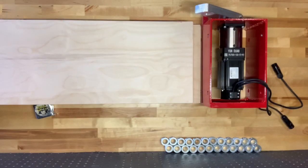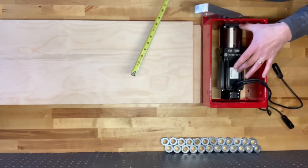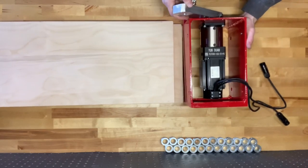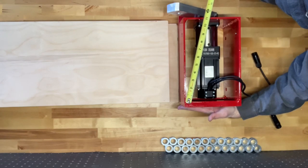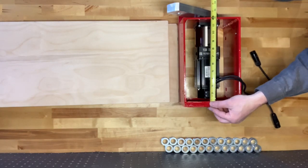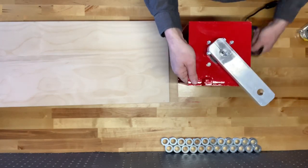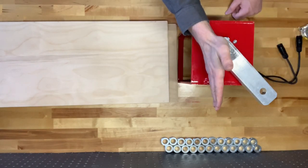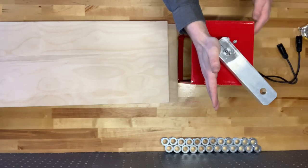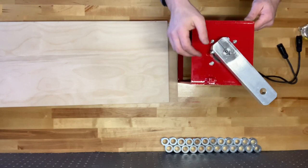One more thing I wanted to mention was the length of these — about 12 inches. The reason is that once the motor is installed, the total length of our cages is 12 inches, so the platform sections are protected right within the cages. I also wanted to point out the hard stop that was welded on. For any calibration that takes place, these will rotate and hit this hard stop welded at the center point of 180 degrees at the bottom. It hits that, calibrates itself using the Thanos controller, and then finds the parked position.